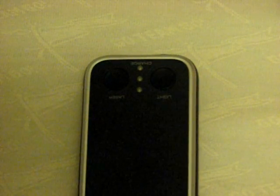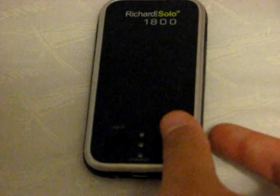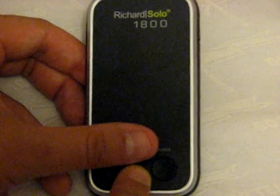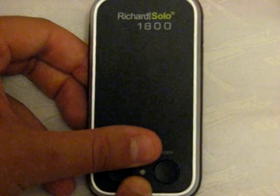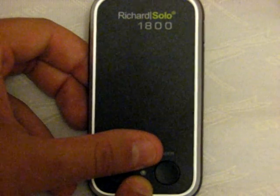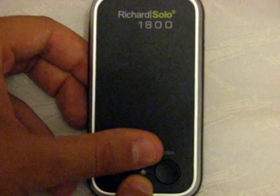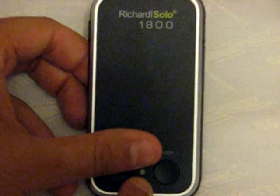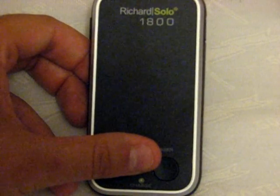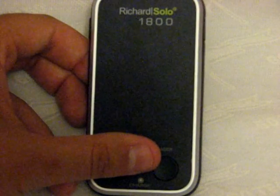The three LED lights in the middle have indicators that tell you how your battery backup is being used. The top one will shine blue when it's lit, meaning it is charging the iPod or iPhone when plugged into your wall. The middle one will shine green, indicating that it is charging the backup battery. The cool thing about the 1800 series is that when plugged into your wall charger, it charges the iPod and iPhone first, and then after they're fully charged, it starts charging the 1800. The lower LED will shine red when you're not plugged into your wall, indicating you're actually using the backup battery as your juice.